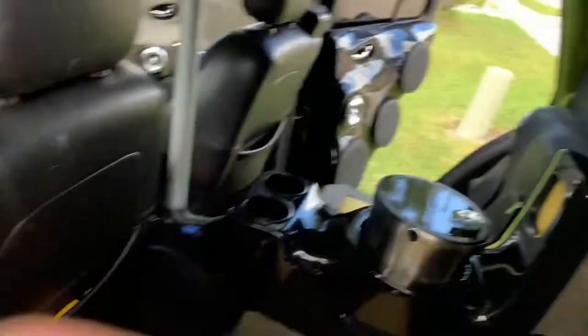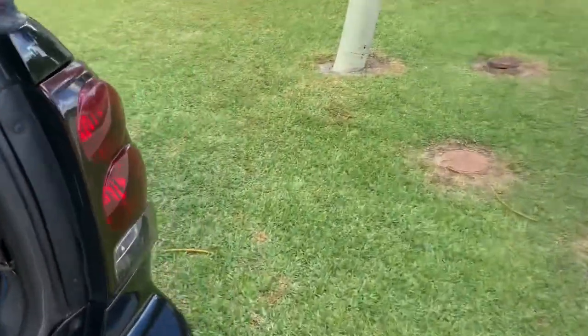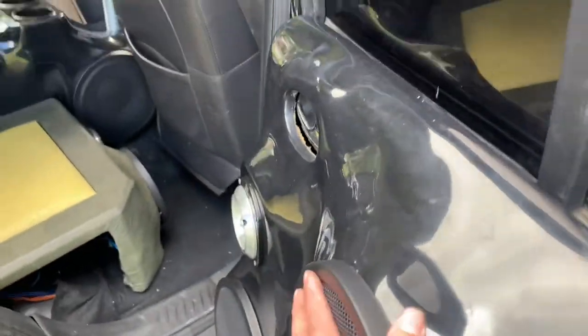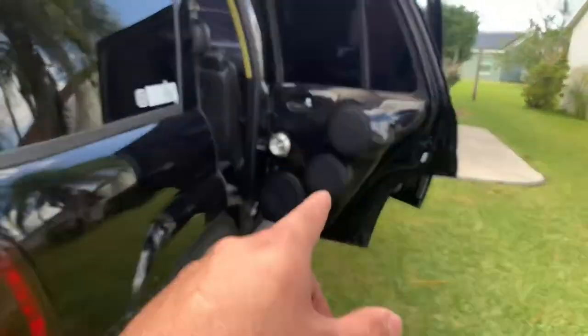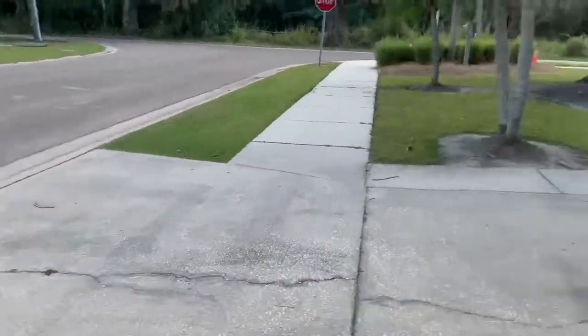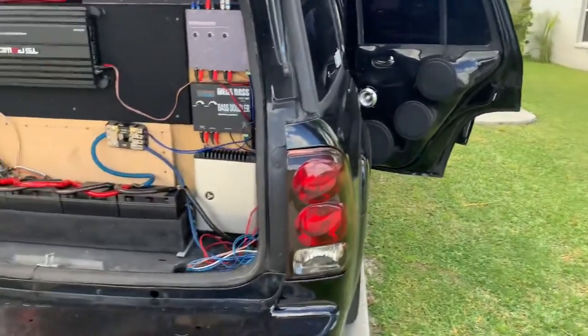I'm actually going to go over all the speakers. These wires I already know are pretty good because I did them the other day. But I'm actually going to take out these and make sure the mounts and everything is good inside, and just make sure there's no wires touching because it clips — it acts like it wants to work but it doesn't want to work. We're going to exclude the idea that there's probably something grounding out in there, barely touching wire or metal.